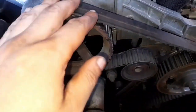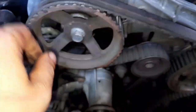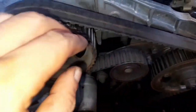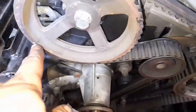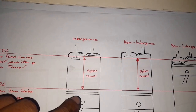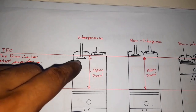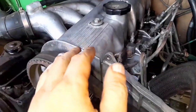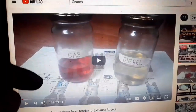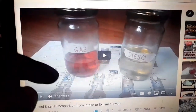The reason why we want to do that is because if you remove the timing belt without first making sure they are all aligned, when we install the new one we're going to have to rotate the crankshaft, the camshaft, and the fuel pump one by one to align them to the timing marks. In so doing, we run the possibility of having the piston bump into the valve, because this is an interference engine.